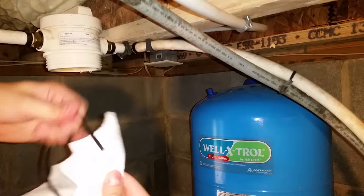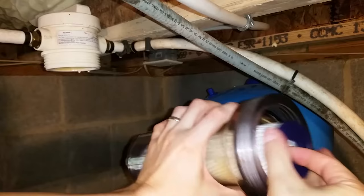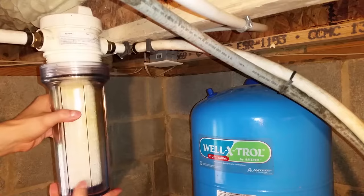Clean and inspect the o-ring. Replace it if you find any cracks. Reinsert the o-ring and the new filter. There's a nub at the bottom of the filter housing that fits into the hole at the end of the new filter. A couple more squirts of the bleach solution for good measure, and then screw the filter housing back on, hand tight only.